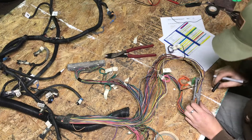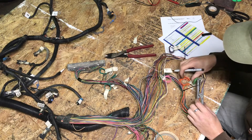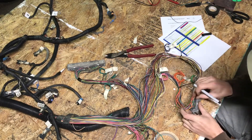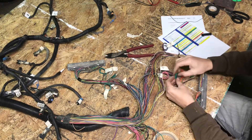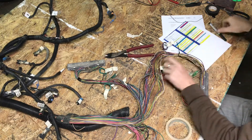Check that one off the list. Pin 57 is our orange which we've already got bundled up. Pin 58 is a dark green — this is for your OBD onboard diagnostic port. Going to go ahead and coil it up. Serial data wire labeled.